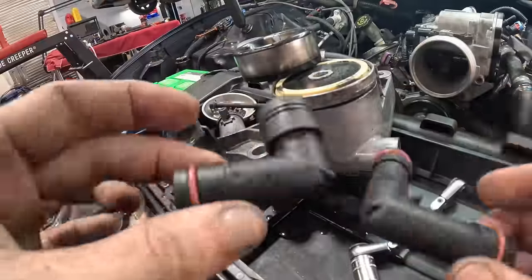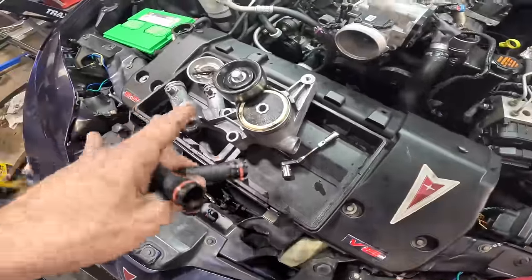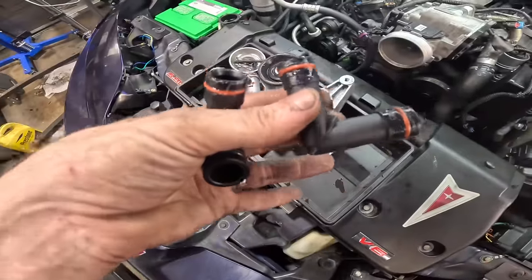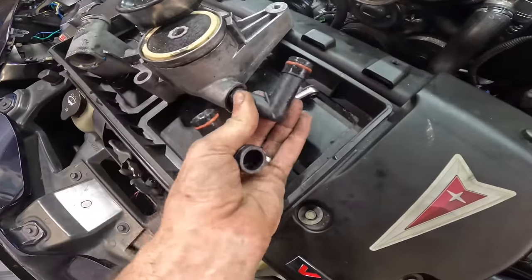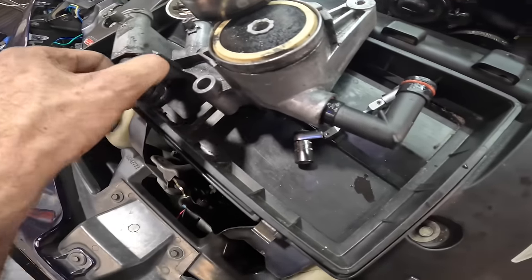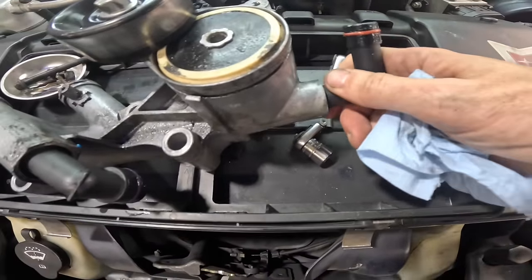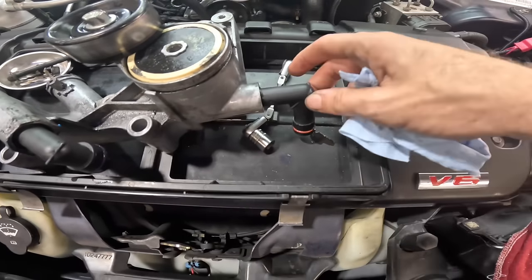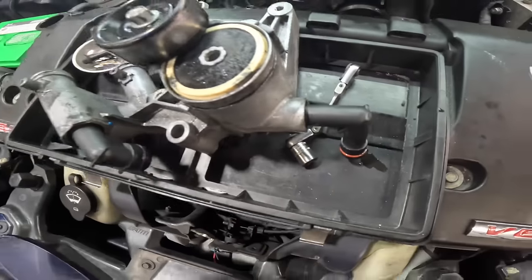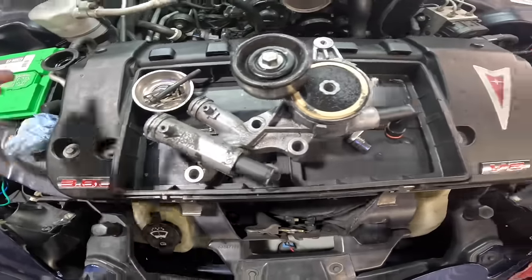All right, back at the vehicle, and we have our heater core bypass hose manifold slash belt tensioner assembly here. Now, in order to connect the cooling system to the vehicle, we've got to use these little elbows. I know what you're going to say. These do exist in a semi-metallic configuration, and unfortunately, I had to go with the plastic ones this time around, because I was not able to acquire the metal ones. They are for some reason back ordered in my area and none of our parts people are showing a listing, so I've got to use the plastic ones. However, it should not be a problem. These things have a good 10 to 12 years of life in them. It was a decision out of necessity and I had to do what I had to do.